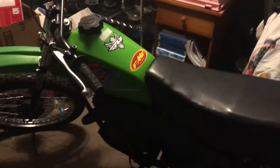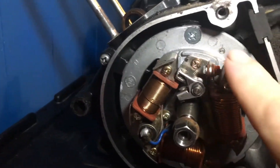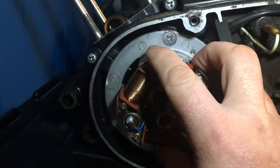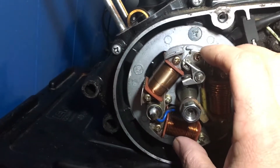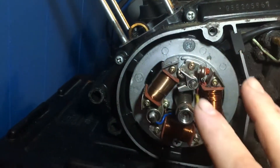All right, so back to this bike right here. After you guys adjust points, some of you have questions about timing. These bikes are not adjustable — you can see right here the screws are fixed, you can't rotate this. If you could, you could adjust the timing. So if you have like a Suzuki DS80 or DS100, or like the Kawasaki 125s, 175s, 200s, some of those have a slide and you can adjust it. I want to talk about confirming that your timing is correct.